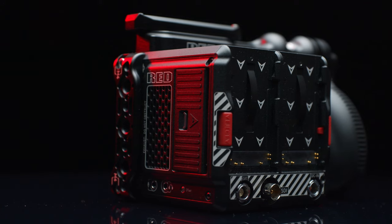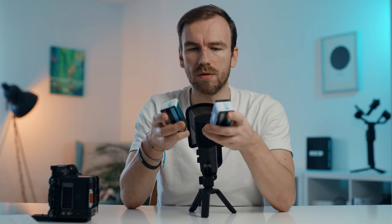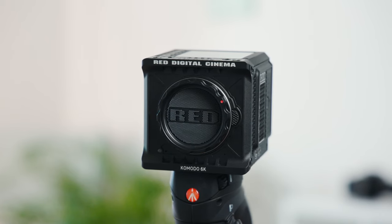Battery life is really great and you can hot-swap batteries — the camera keeps running while you swap. With one 955 battery you get roughly one hour to one hour ten minutes, so with both batteries about two and a half hours. I personally have seven batteries now including some 975s. These batteries are expensive and often out of stock, so I had to use non-approved batteries initially. I highly recommend using Canon-approved ones.